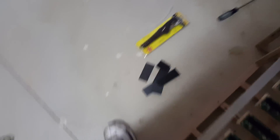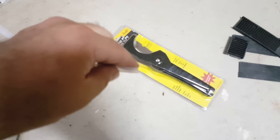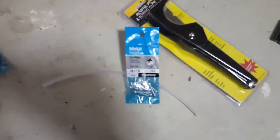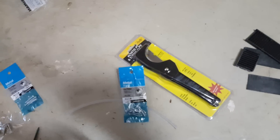I'm going to go ahead and wrap up the video here. The next step is to place your motherboard right in here. You're going to use simple spacers you can buy at Home Depot or Lowe's. I found it to be cheaper to just go to the plumbing aisle, buy some tubing, pick a measurement, and cut them all to that length. Use those along with your screws — number six, one inch — and use pipe cutters to cut the tubing.